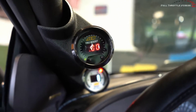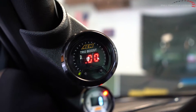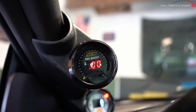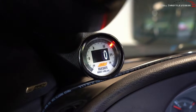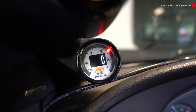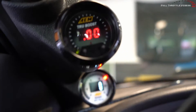I've got these gauges rigged up — the top one is the AEM true boost, which is the boost controller on the outlet side, pretty much my intake, so this is after the intercooler. My other wideband gauge that also reads boost is coming right out of the turbo, so before the intercooler. We'll compare the boost between the two.